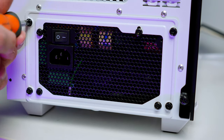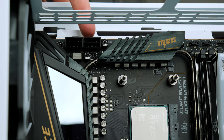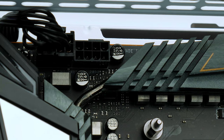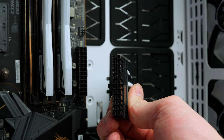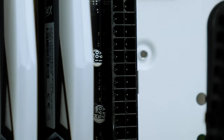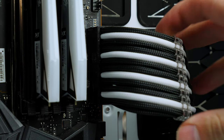To make things easier, go ahead and connect some cables now. Grab the 8-pin CPU cable — on this power supply it's two 4-pin connectors — and plug it into the CPU power slot. Next, power the motherboard using the 24-pin cable; mine has an extension purely for aesthetics. Plug it into the slot on the motherboard and give it a firm press to ensure it's seated correctly.